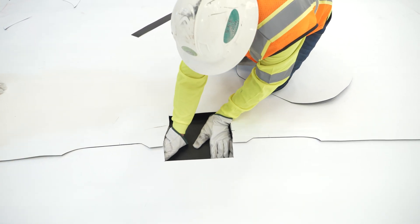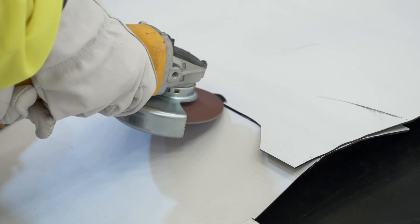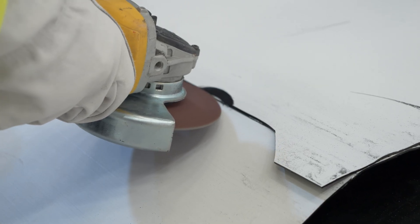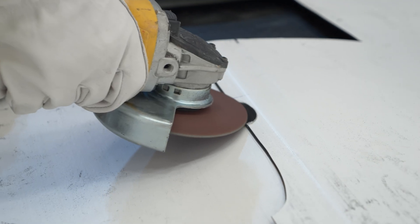At this point, the flap is not isolated. To isolate the flap, grind through the squeeze-out bead about halfway through the weld track of the top panel. Complete this process on both sides of the patch.